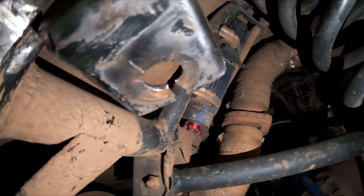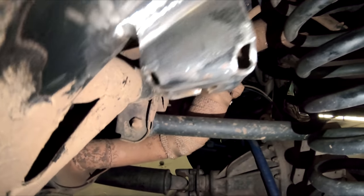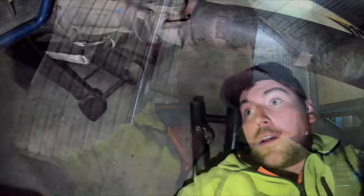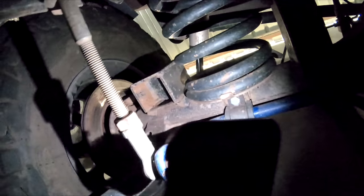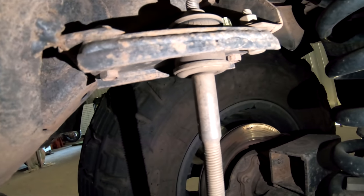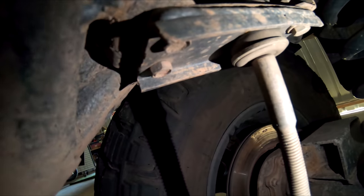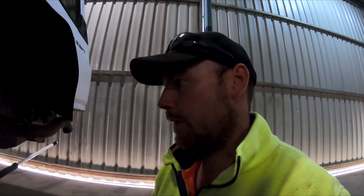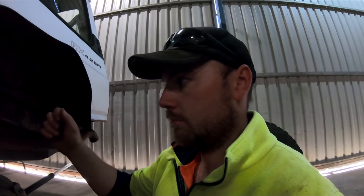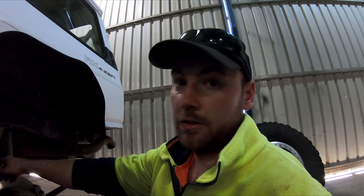It's all cracked out around the hole and it was actually a bit bent, pushed up on the sides. I'll show you the other side quickly - this happened last year or whatever. If you can see, I've already put a bit of 4mm plate on it because it cracked all that and punched it through. Unfortunately, that's what happens when you run a heavy duty sway bar, because the chassis mounts weren't made to have such a heavy sway bar on them.